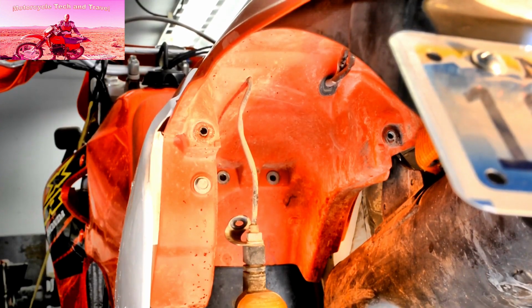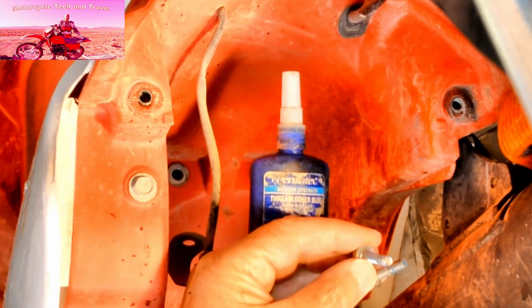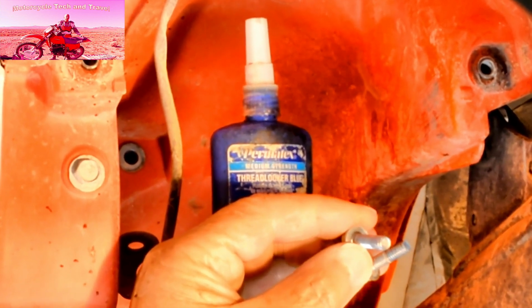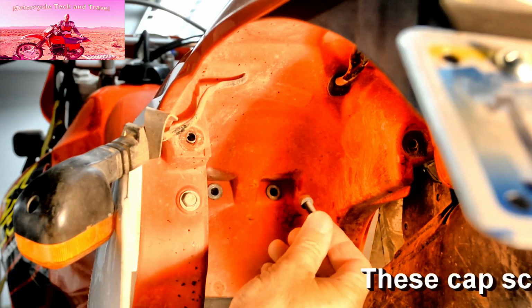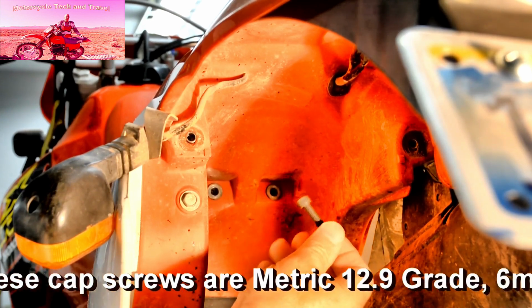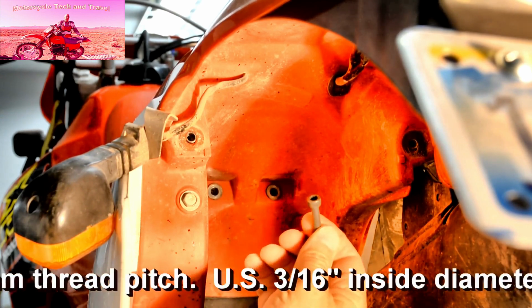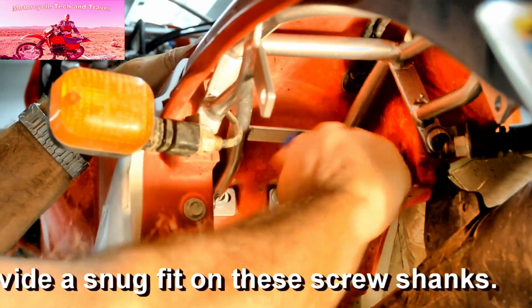Here the 4 bolts are removed that support the rear fender. We use Loctite 242 medium strength on hardware. It's insurance that the hardware won't rattle loose on washboard roads. We're using the existing bolt holes for the fender support. Instead of reusing the original hardware, we've gone slightly longer and improved the hardware. These are Allen head. We'll use 242 Loctite and fender washers on these bolts. Secure the hardware.